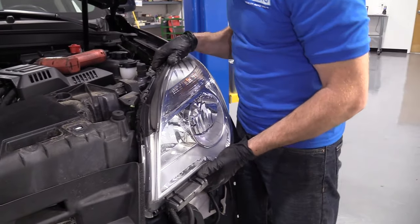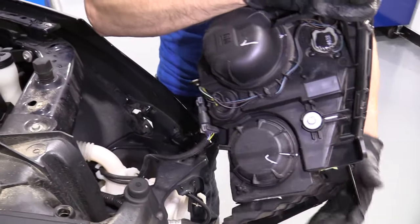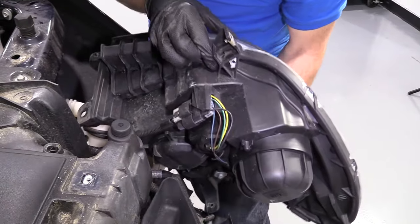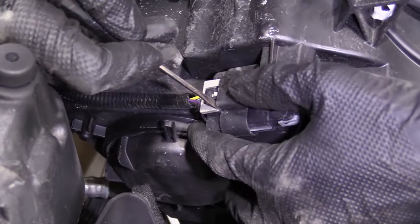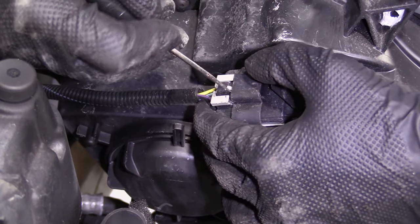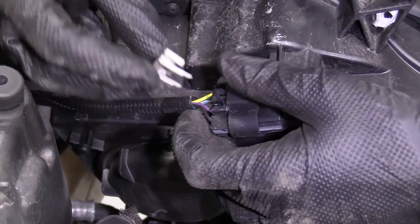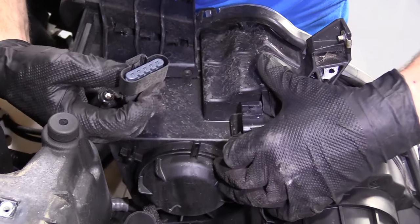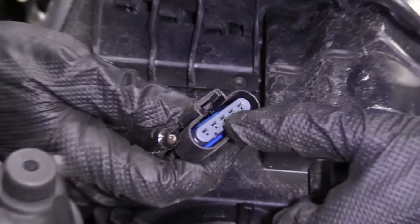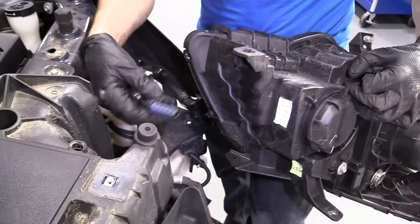Now I'm going to take our unit and just lift it up. Got a little bit of wiring back here. We're going to use our pocket screwdriver again. This gray thing right here is just a lock — you want to try to push it in and up. That just prevents this from being able to get pulled out. Now that we have it off, take a peek inside here — this is the wiring harness. If you see any funny colors, rainbow colors, rust, debris, water, anything, you want to make sure it's cleaned up or replaced.